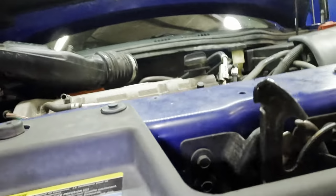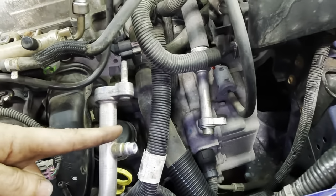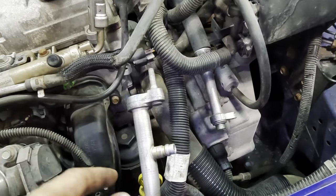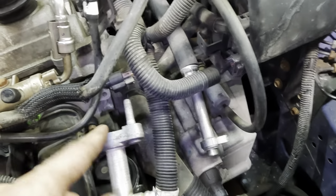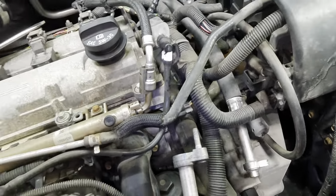That one right there on the bottom. That's the one. Let's pull that guy out, and we'll try to blow that line. It's going to blow through the compressor. But as it exits the compressor, it's gonna come through this line right here, and hopefully it'll blow all that debris out of the hole. When I put the air pressure to it, I'm gonna put you guys up here to keep an eye on that, and you let me know if that piece of metal comes flying out or not.